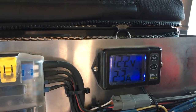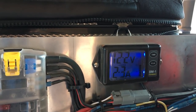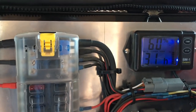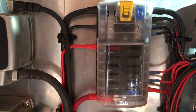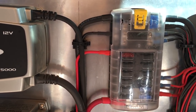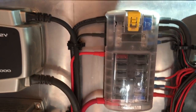This is a NASA BM-1 — it's a power management system, though it really just tells me what's going on. Right now it's telling me I'm at 60% and have about 31 hours at this draw. This 12-position fuse holder is for my auxiliary side. I haven't put a lot of auxiliary camp lights in because I've got good lanterns and haven't felt a real need, but I've got plenty of capacity to do that. This six-position panel is the vehicle or start side.